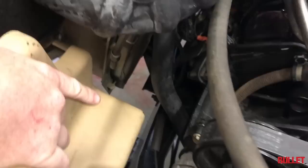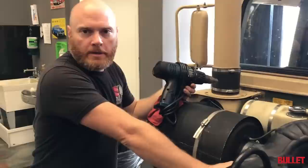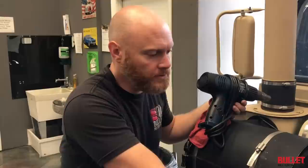This had a three-way pipe on it, brass fitting. So the line goes to the differentials, it goes to different parts on the truck that they want vented, mainly the differentials, and one other place that it went to was the old mechanical fuel pump. So what we had to do was take off that line, because now we have the electronic fuel pump. And so now I'm just putting the ends of that line together to keep it sealed, to make it look better. You can't even see it.